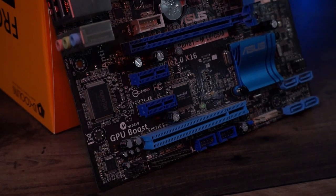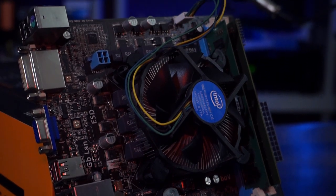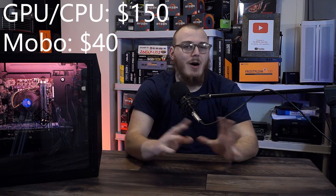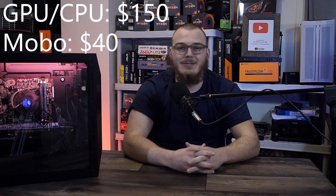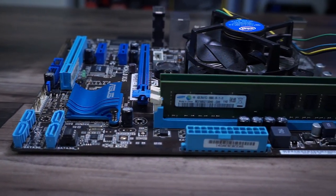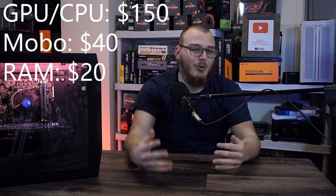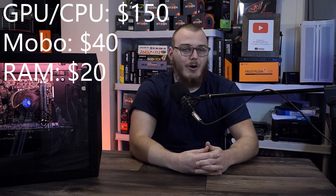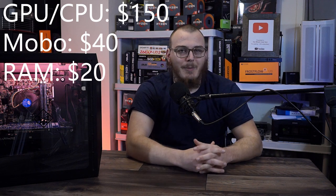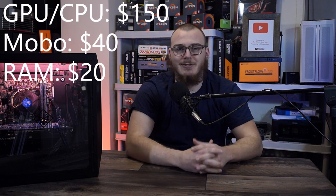For the motherboard, I went with the Asus P8 H61. Basically any LGA 1155 socket motherboard that works with the chip and is a relatively good price — anything around $50 or less — will work just fine. You could go the Dell OptiPlex motherboard route, but there are some minor inconveniences with that, so I'd stick with a DIY motherboard built for putting into a case. To keep the budget down, I went with 8GB of DDR3 RAM for about $20. I'm sure people will argue I should have gone with 16GB, but since this is an extreme budget build and 16GB is kind of a luxury, we went with 8GB to make sure everything is relatively paired together.